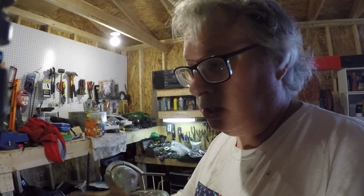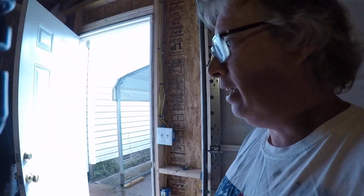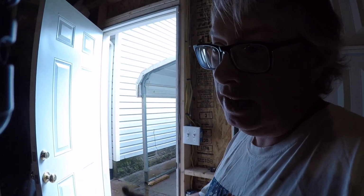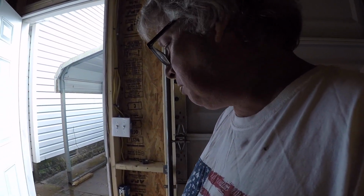But if it looks like it's in pretty decent shape, then you don't have to pull the power head. You just got to loosen that bottom cowl by taking the support brackets off, and then you can get down where you can get all the bolts out of the side plate. So anyway, that's what's going on with that. And I just got the guy's Johnson out here started up, ran great, and he's pretty happy.